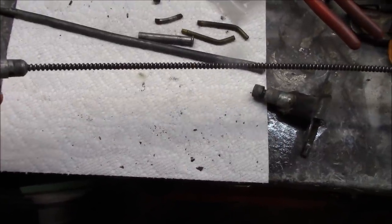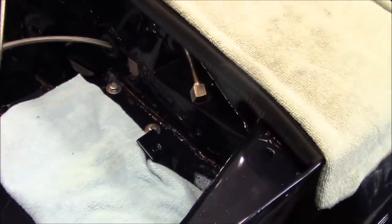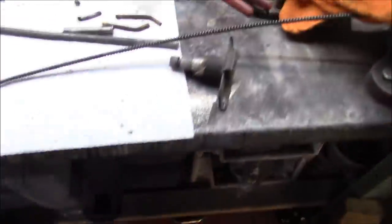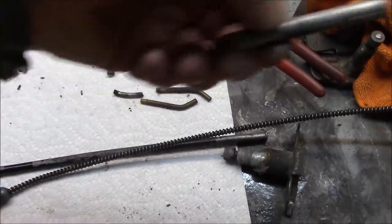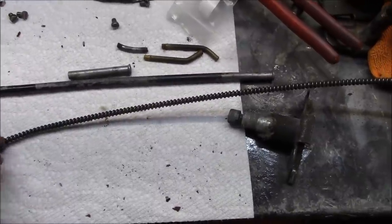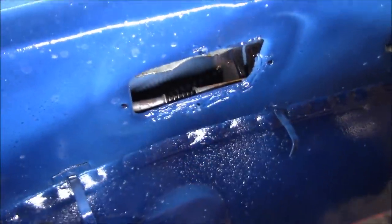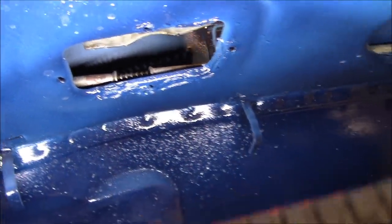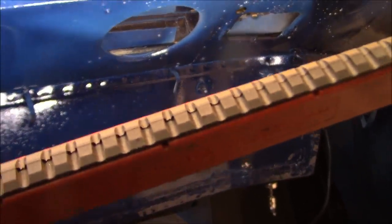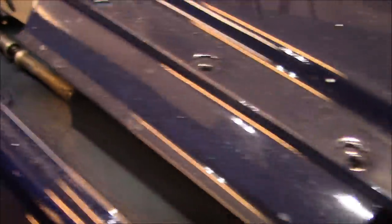Next I'm going to try to feed the rack cable through the piping here on the bulkhead. I've got the one pipe in — that's the leading pipe. It goes through a center pipe that fits between the two wheel boxes, and there are little channels in the wheel boxes for it to fit in. Then there's the pipe on the very end on the passenger side. Be careful you do not lose the small end piece down the scuttle, or you'll never retrieve it without a magnet. You can see the tube running through and the wheel box aligned between the two tubes.